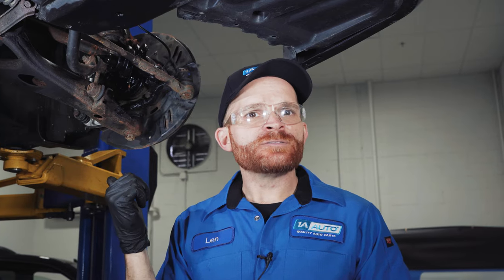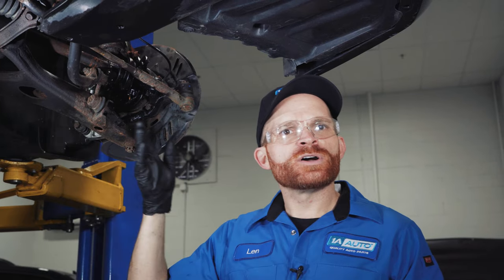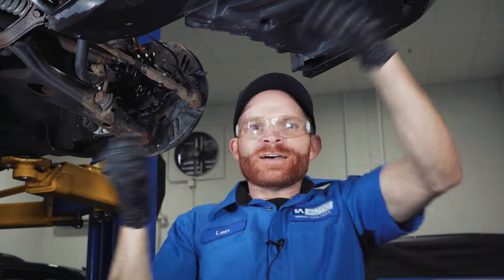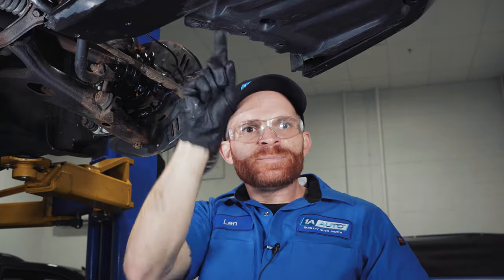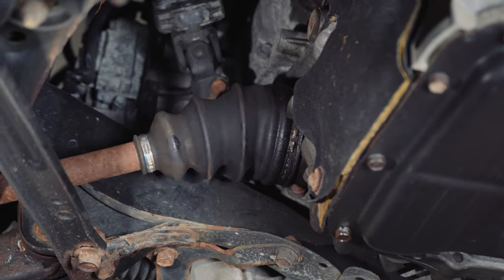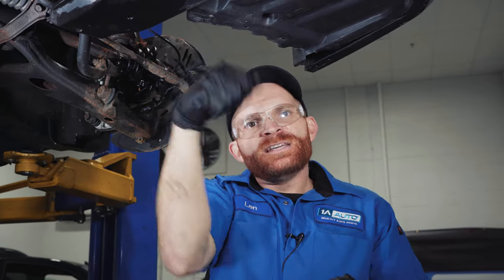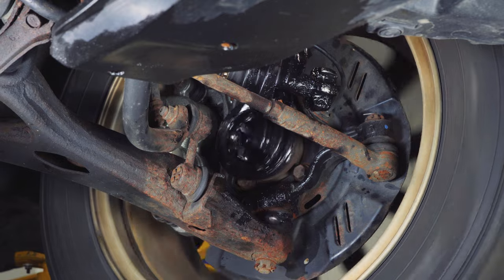If that wheel bearing were to get bad enough, it could potentially cause a serious issue with the axle, as you can see. The axle is connected to your transmission and goes all the way over to the backside of the wheel bearing, which is located at the steering knuckle. That axle is going to be spinning very fast as you're driving down the road — that's what it's meant to do. The joint should be able to pivot just a tiny bit as you're hitting bumps going up and down while spinning. But if the wheel bearing can move like this while you're driving, the axle shaft is going to be doing the same and it's going to cause a lot of wear. If it's doing that and you're making a sharp turn, that joint is going to be at a sharp angle, causing even more wear and potentially even breaking apart like this one did here.